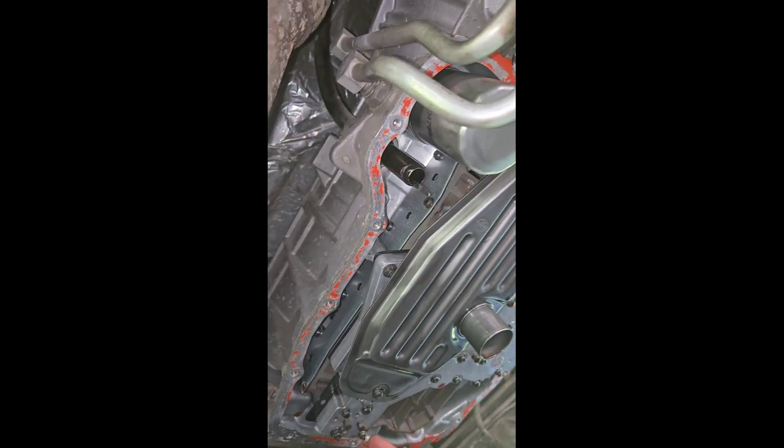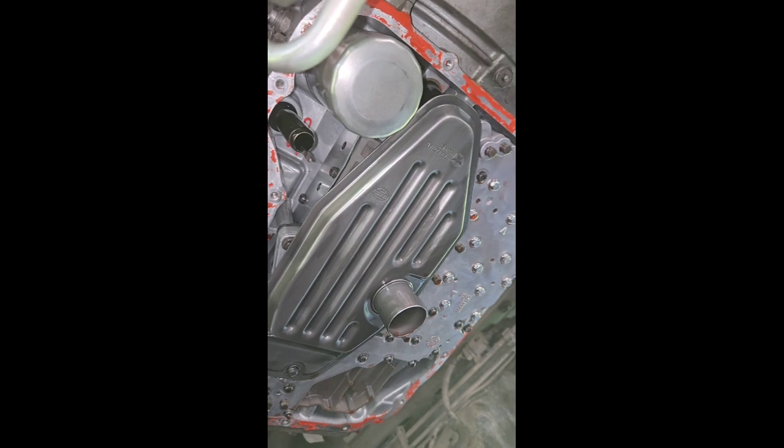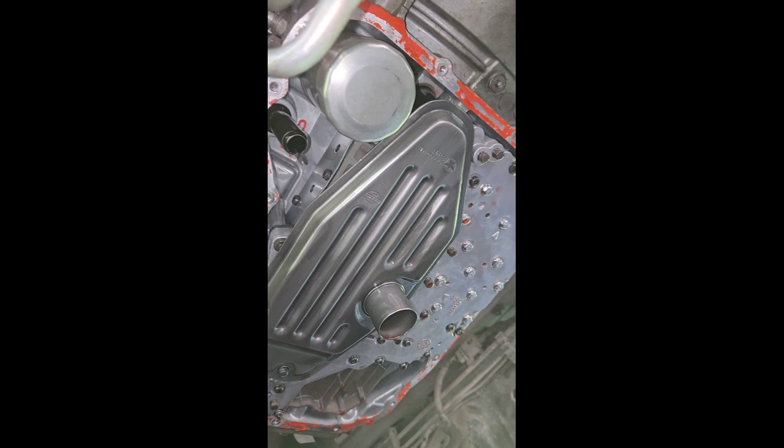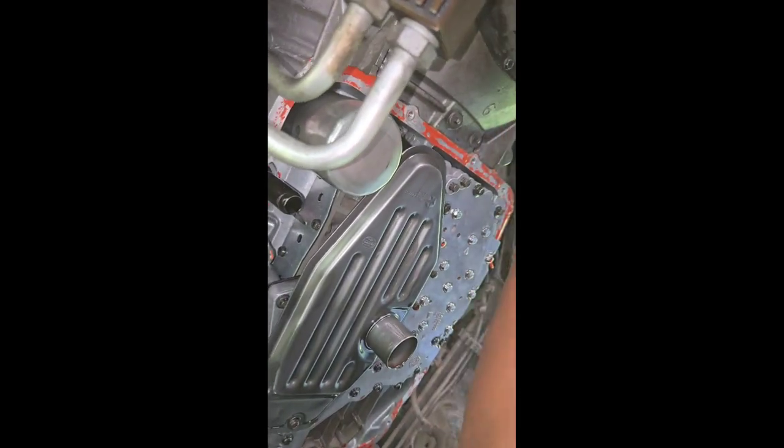And so some people will say, oh, don't touch it. Don't go inside of that transmission. And for these newer vehicles that have these smart transmissions, you need to touch it. You need to go inside of the transmission, because if the filters get clogged and you never change these filters, they can restrict fluid flow. And then after you go in these transmissions, they're smart. You have to put a computer on it. So even after filling it with fluid, letting it run, getting the temperature up, and driving it for a while, making sure that you have the proper fluid level in it, then you have to put a computer on it and do what is called, on this particular transmission, a trans relearn.